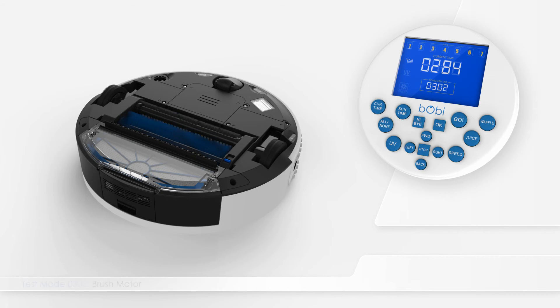After testing the brush, press left on the remote again and you will see the digits 0303 in the test mode indicator. The vacuum motor starts working and the main four-digit number on the remote screen shows the current of the vacuum motor. A standard current range for the vacuum motor is between 160 and 250 milliamps.